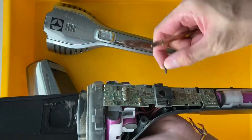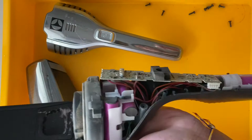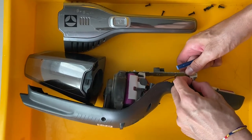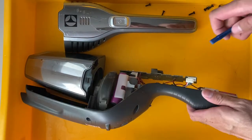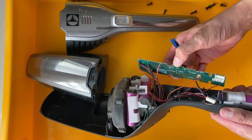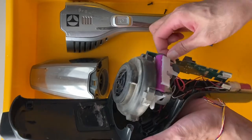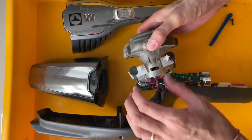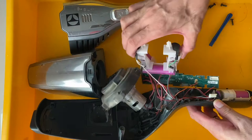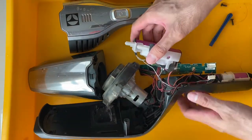Next, I need to remove the two mounting screws using a hand screwdriver, not a power tool. One good benefit is that the video lets me see how the wire is laid and hidden in the chamber, so I know how to route it back later. This is actually the charging cable, and at the front is the DC motor and the battery pack with its housing — it looks like a V-shape. Underneath are two prongs used to hold the battery in place. Carefully remove it, and make a video or take a picture so you know which battery goes where.